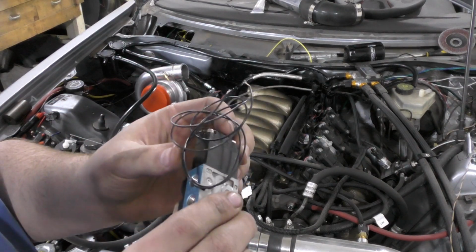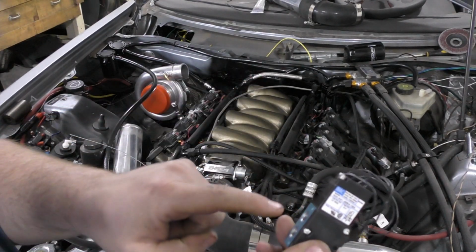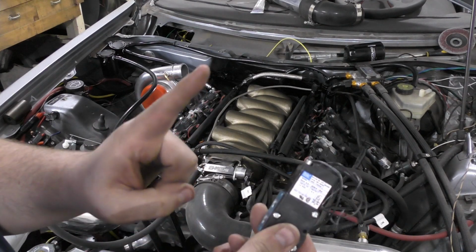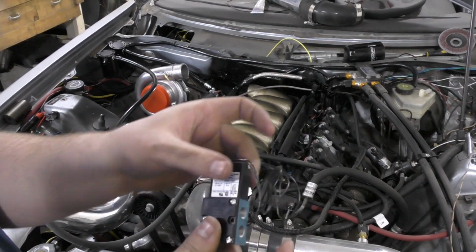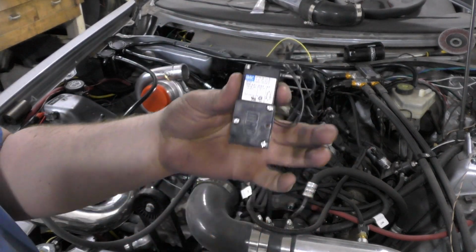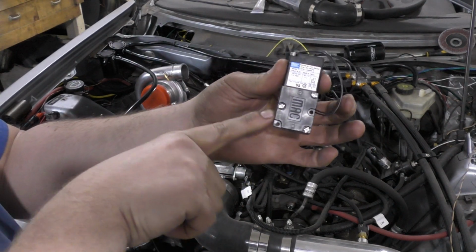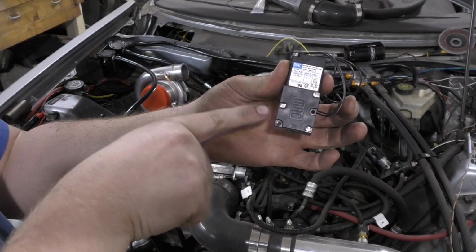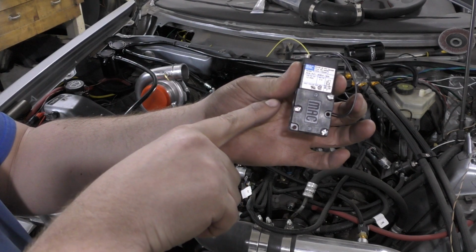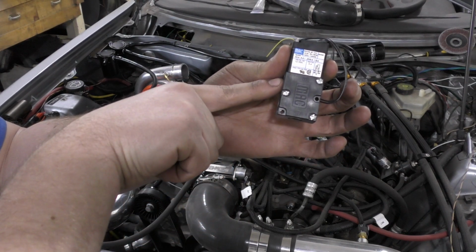These are kind of interesting because you have your intake and exhaust port, and then you put one to the bottom of the wastegate and one to the top of the wastegate. Depending on your duty cycle, from 0 to, I think it's 50%, everything's modified through here, so it's adding air, removing air. But above that 50% to 100%, it's adding and subtracting air to the top.